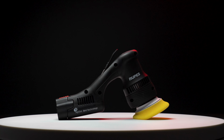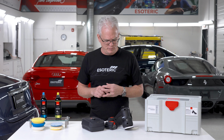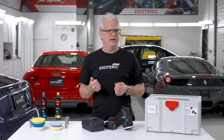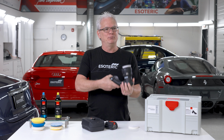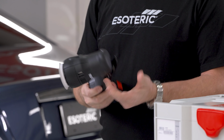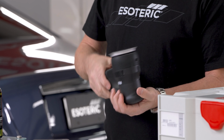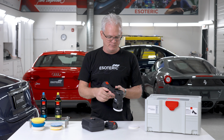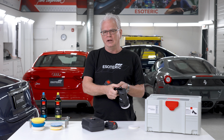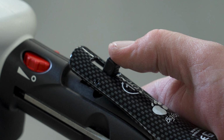Okay, I talked about all of the likes that I have. I talked about all the ways that you can use this. Do I see anything that I would like to see improvement on? Oh, there's only one little thing that I want to make you aware of that can make a mess. With this trigger right here, a lot of times it's easy. People are going to put it over in their hand when they go to put polish or compound on the surface. When you do that and it's turned on, it's easy to put it in your hand and start it when you didn't want it to start. And if you've just put polish on there and you hit that button, you've got a great big mess. I wish they had that. There's a little toggle on the LHR75 pneumatic that you have to push forward to activate it. I wish they had that on there, but that's just a tiny little gripe.